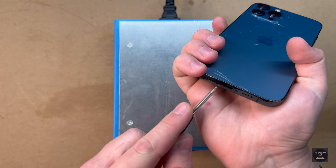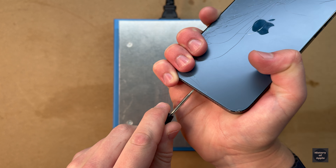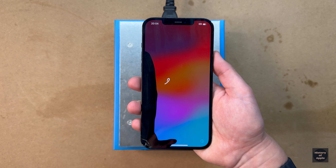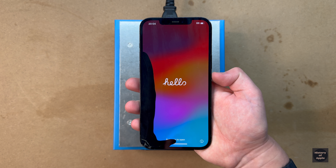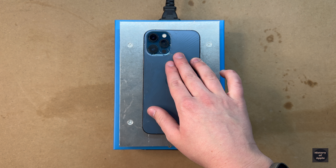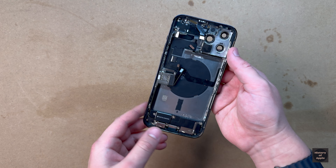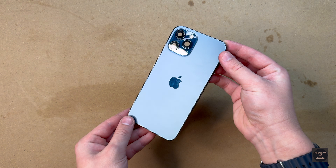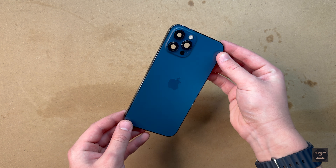To begin the repair, I'll go ahead and remove the bottom security screws. While I work on that and begin to cook the iPhone, in its current condition both the back glass and screen need to be replaced. The screen has very little touch sensitivity, making it impossible to get past the hello screen or power it off. As I don't have an expensive laser, I'll be replacing the entire housing — Apple doesn't offer this part, so I had to buy it second hand on eBay.